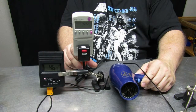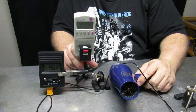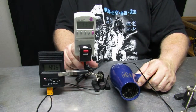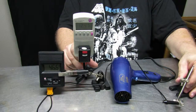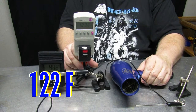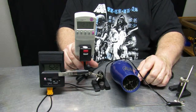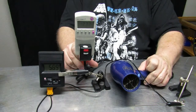The low setting is about 300 watts. The high setting is about four times that — around 1,200 to 1,300 watts. The hair dryer also has a setting where, if you push a button, the heaters stop but it still blows air, giving you a cool blast. That cool setting uses about 90 to 130 watts, as observed on the meter.